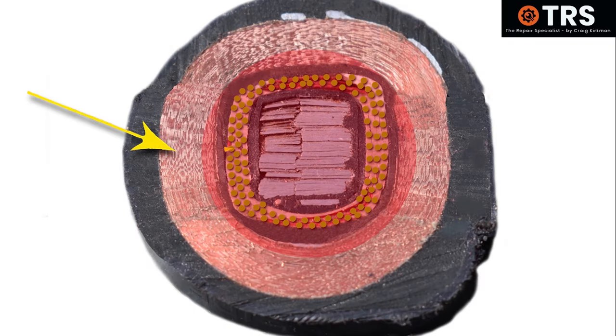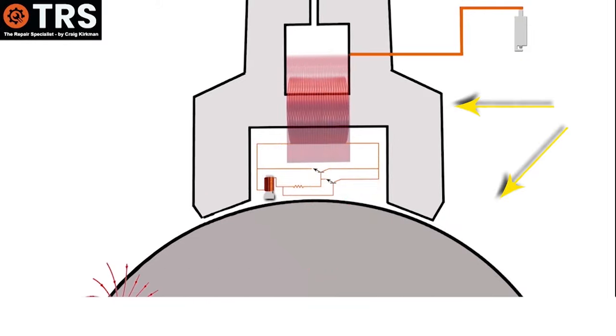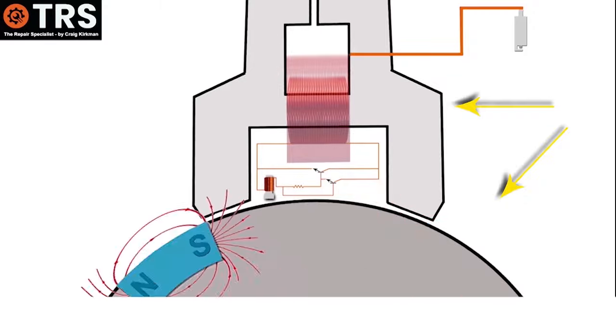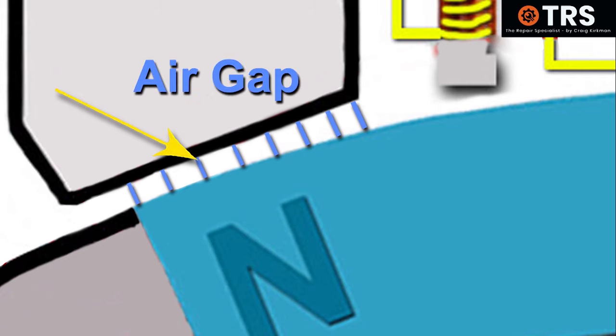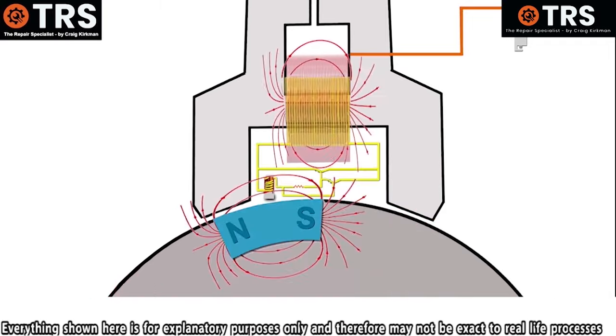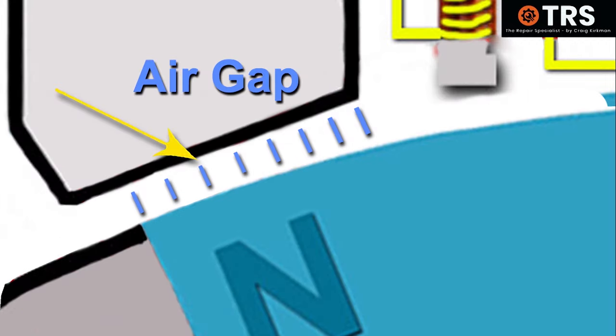So the question is, what could possibly cause this? There are things both inside and outside the coil. One well-known external cause is the gap between the fixed magnet on the flywheel and the coil pack — it requires a specifically set distance between the magnet and the coil pack. If the distance is too great, the fixed magnet being too far away, it's not going to produce the same amount of electron flow current through the primary coil, resulting in a less sufficient electromagnetic field. It's always best to check the manufacturer's specifications for what this gap should be.